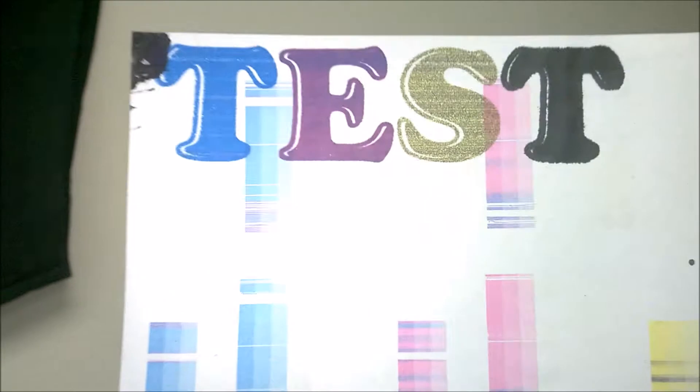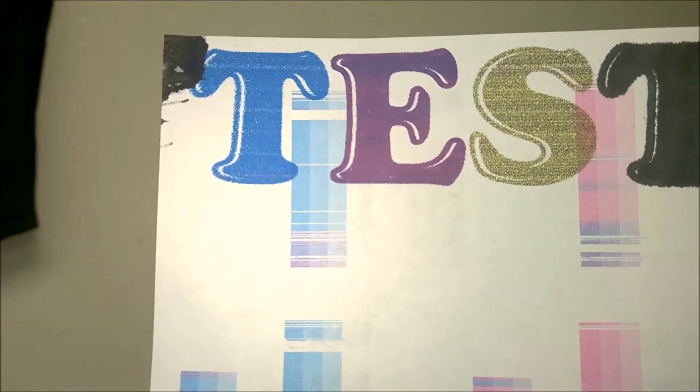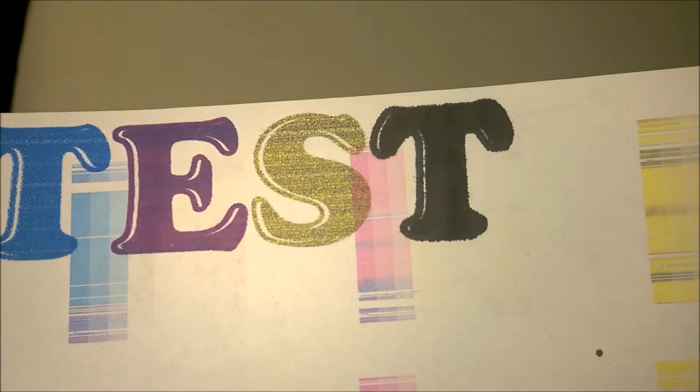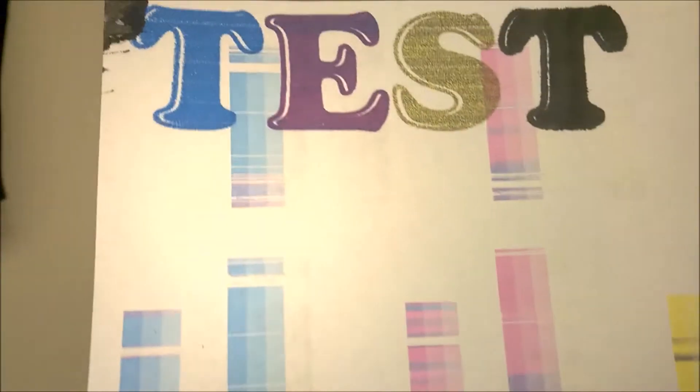I couldn't get it clean. The magenta did it a little bit, but not as much, and it would be repetitive. I'd do it over and over again, trying to clean the print heads, and it was doing it every time — it didn't matter how much cleaning I did. And this is what it looked like when I was doing a test: the magenta and the blue mixed and made purple, and then the black and the yellow were mixing.